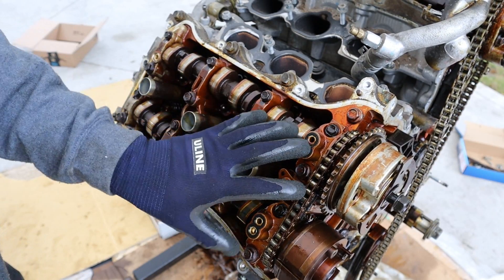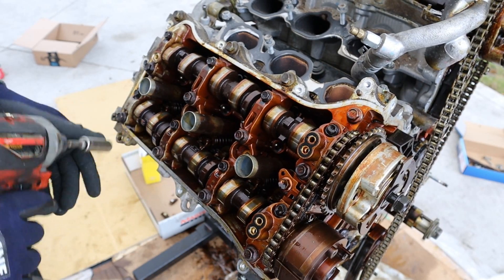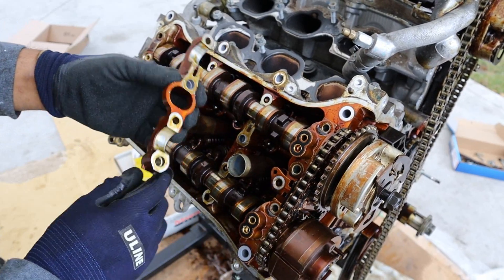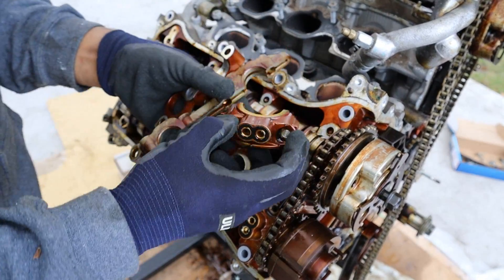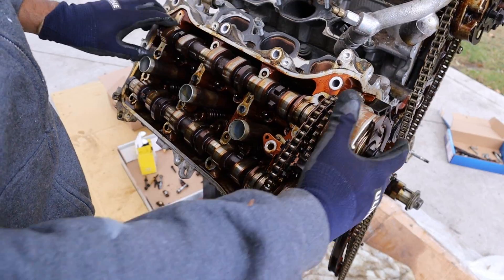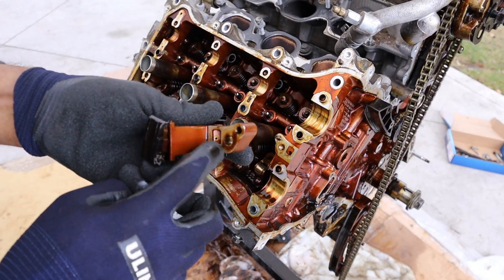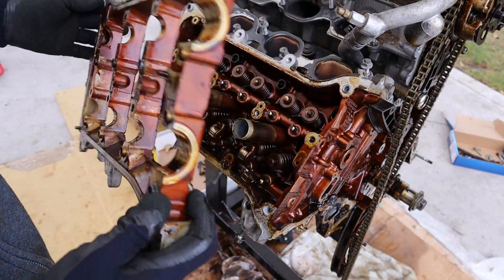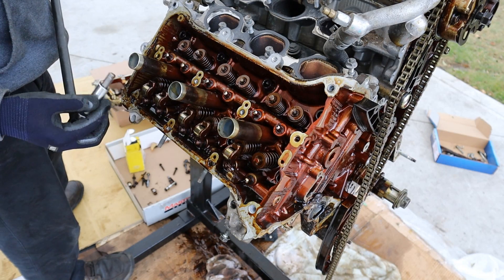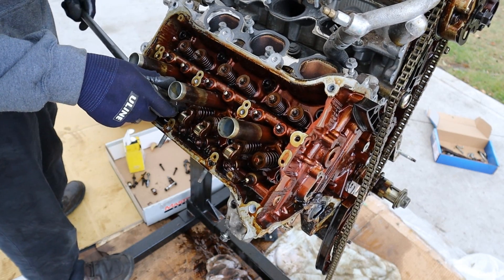This is actually a kind of ladder frame cradle that sits on top of the engine head, providing cam caps all in one piece — held in by a bunch of 12s and 10s. Actually, it's more of a semi-circular cradle, with the variable valve timing holes at the top. Looking at the cam caps, I don't see any indication of oil starvation. I'm going to remove the camshafts together. This is also a hydraulic tensioner. The bottom part of the camshaft has this cradle housing the lower portion of the bearing, and the bearing surfaces look to be in good condition.